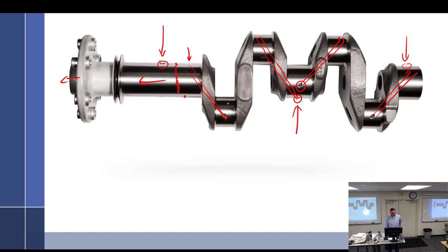So we've got pressure oiling feeding all of those bearings — oil comes through, pressure-feeds the bearing, drips out, splashes around, and drips down to the oil sump. That's the end of its cycle. A long time ago, Lycoming didn't have tubes like this — they actually put a different type of plug in here to create a chamber, with another hole drilled out from the chamber going up.